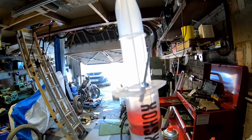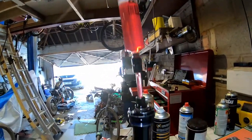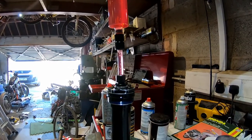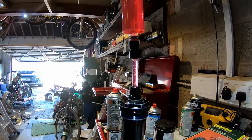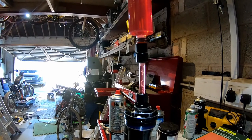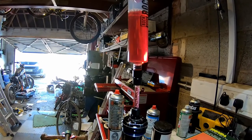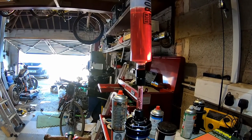I've held the syringe at a vacuum and you'll see the bubbles rising. I'm going to leave that for a good 10-15 minutes, then come back, cycle it a few times, and do it again. The idea is to try and get as much of the air out as possible.